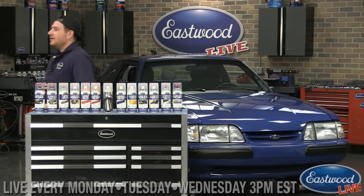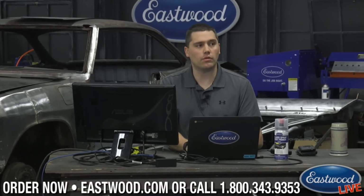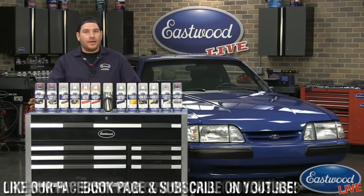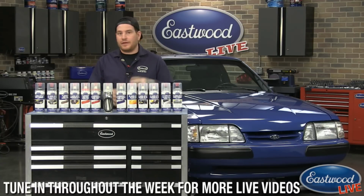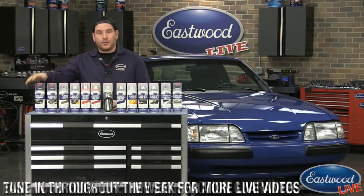And then one other question is regarding the primers. They want to know if you can paint right over body filler. Specifically the primers they're asking about. Yeah, so the same as if you're doing your bodywork techniques, there's kind of two schools of thought on that. Some people like to put their body filler right on bare metal and then do the primer over top of it. Some people like to put epoxy primer down and then do their body filler over top. There's all different opinions on that.